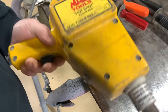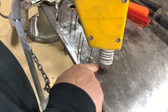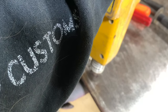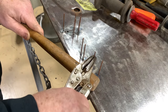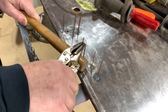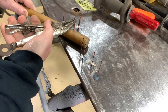I've had this stud gun for about 20 years — it's a Mac Tool; Snap-on makes them too, and there are many different brands now. You insert one of the little copper electrodes in there, find your dent, push down over it, and pull the trigger. You can see the little bright mark right there. Let's see if we can get this dent out with the stud puller. We've already tweaked it enough — that's all it took. By doing this you're eliminating the need for a lot of extra body filler, and in some cases you can metal-finish all of it with no body filler at all if you want to take that much time.